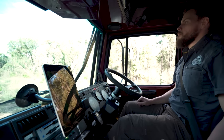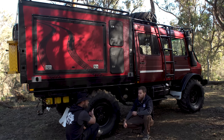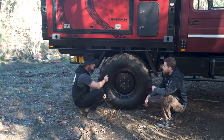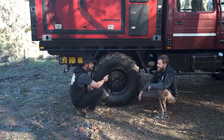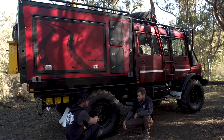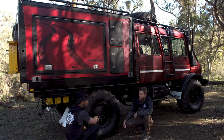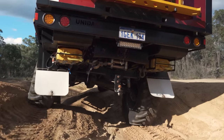Corrugations wouldn't feel much in this, would you? No, but you drop down to maybe 35 and you really feel nothing. These tires are so big, they kind of roll over any of the normal corrugations caused by 30 to 35 inch tires. You don't even really feel them, especially if you make them a little softer. You need a Unimog convoy to be able to feel them. If I'm out on the sand, I go down to, I think the lowest I've gone is probably about 15. Just scared of ever losing a bead because I really don't want to change any of these tires. That'd be a pain to put on, wouldn't it? Yeah. Okay, excellent. Well, I think we're done with the tires.